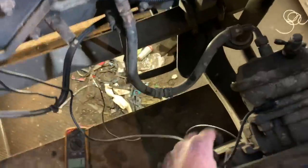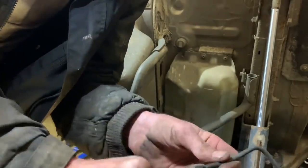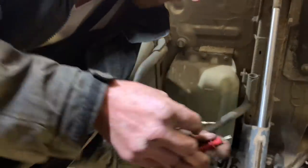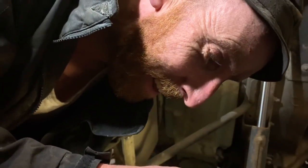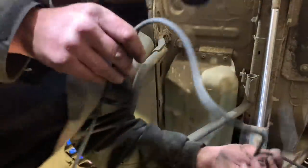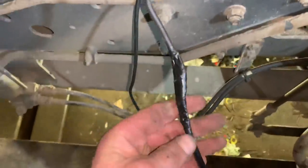So I may as well chop it there and try it. I have my sensor — that plugs into there, but I wouldn't have thought it would break in the chassis. So I'm going to chop it here and try it, connect the power there to the back to the valve. This cable is plugged into that multi-plug. So somewhere between there and the plug there, there's a break. All I need to do now — snip that, get a new one of these, plug into it, job's a good one. I've joined her up there with link connectors, then put a bit of nice insulation tape. So in like two years' time it can corrode, and then we can have the same problem again. But at least someone will see the tape and know where to look.